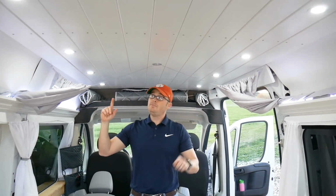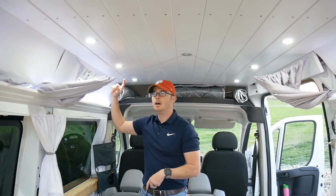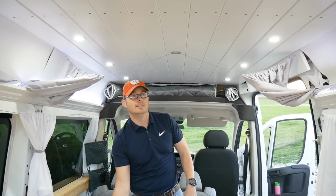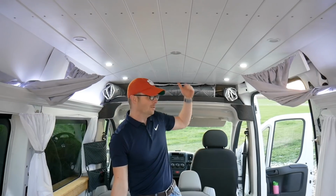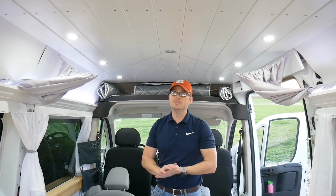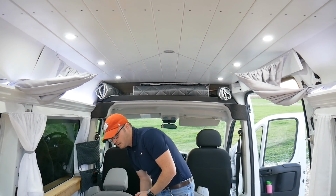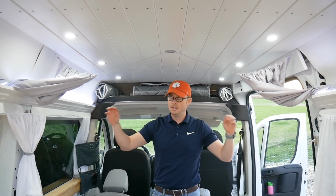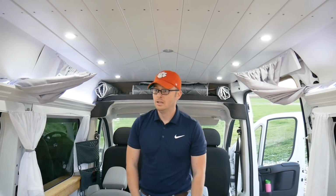The ceiling. We used, I believe, 12 LED lights. These are these nice lights. They're all run through, they have their switches over here. And we broke them into series, so you have some for this area, another one for the kitchen area, another one for the bathroom area. We really do enjoy these LED lights, and they're only pulling, I've got 1, 2, 3, so I've got 14 lights plus these LED overlights, and we're pulling roughly about 2 amps right now. It's fantastic.